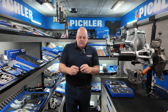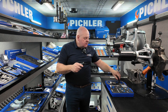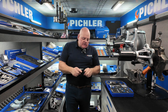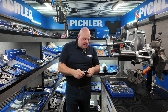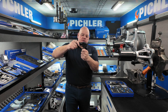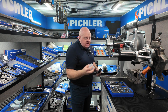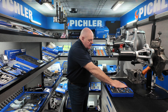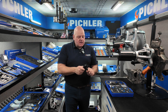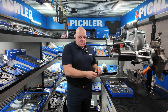The flaring tool is operated with a ratchet socket in situ or a spanner, so all you need is enough space to get inside and flare it. It does a really nice flare. The big test, as we all know, is flaring steel pipe on the car, and we guarantee this will flare steel pipe on the car no problem. You've got your indicator so when the flare's done you pull that back and in you go. You've got single and double stage flare adapters as well. The big feature of this tool is it will flare steel pipe on the vehicle in very confined spaces.